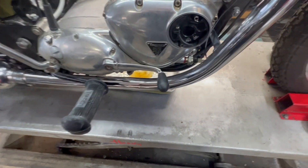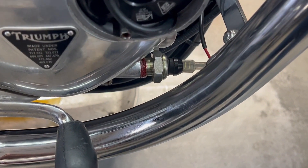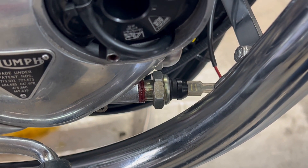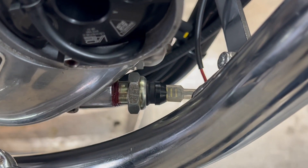A little follow-up on the bike. I was able to clean up the threads on this oil pressure sender. I had the right tap to get in there and was very careful to re-cut the threads. It screwed in just beautifully and is nice and tight, so I don't see there's any problem there.